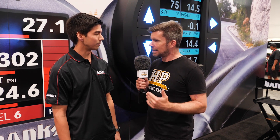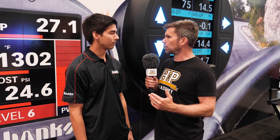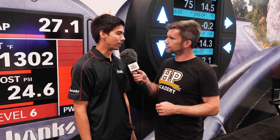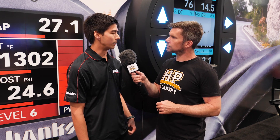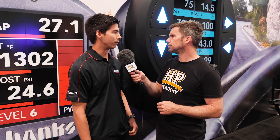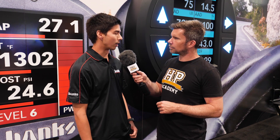So Chris, talking about the problem just highlighted — it is getting increasingly difficult to reflash these factory ECUs. Can you tell us what problems the aftermarket reflashing companies are facing and why it's getting harder? So the OEM manufacturers are basically encrypting these ECUs to the point that no one can crack them. Historically people were getting inside information to figure out how to unencrypt them, but it's just getting harder and harder, and many modern vehicles are hitting a brick wall.